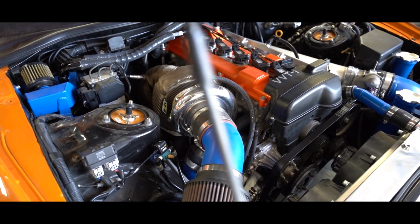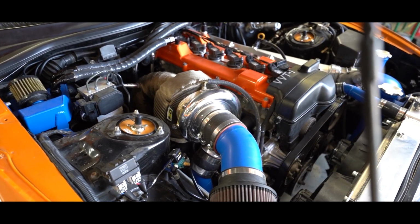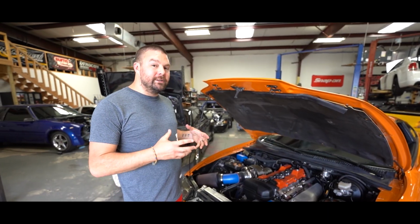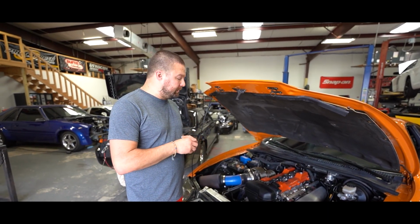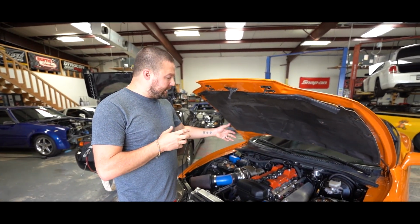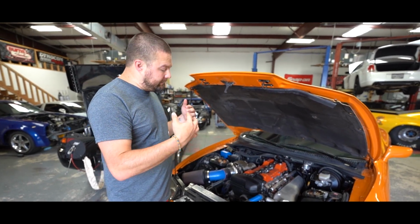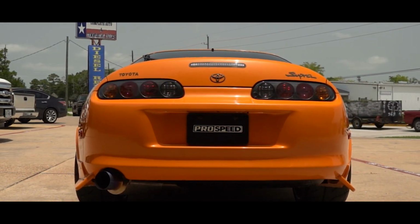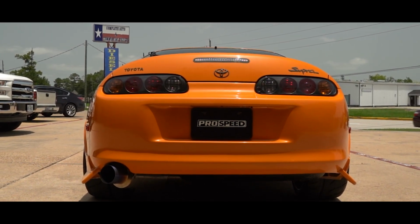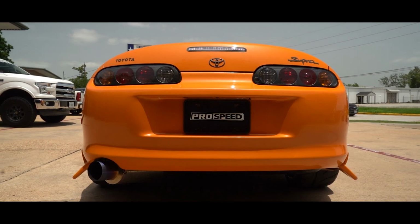Vitaly over at MoTeC USA has been working on a 6R80 package for the Mustang, and I spoke with him and I was like, hey, could we do a standalone version of your 6R80 control that has a bi-directional CAN communication, and I can get Jason from Pro EFI to write the other side of that and have them talk to each other. That way we have a fully functioning transmission controller with all the proper things that you need to really make this transmission live. Everybody agreed to it, and that's what we ended up doing.